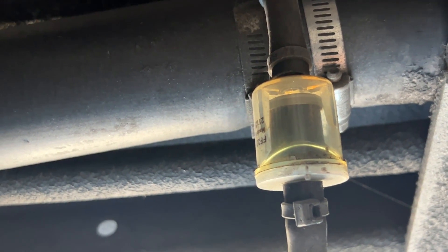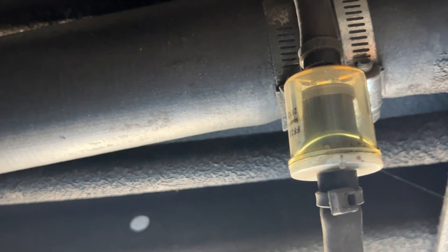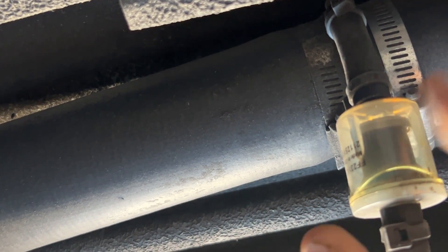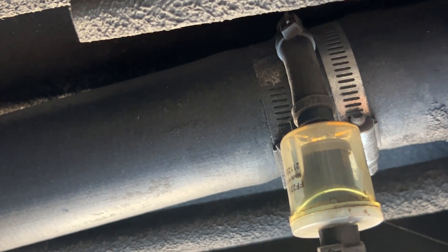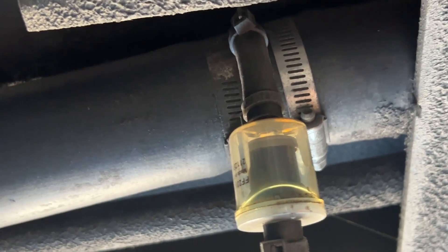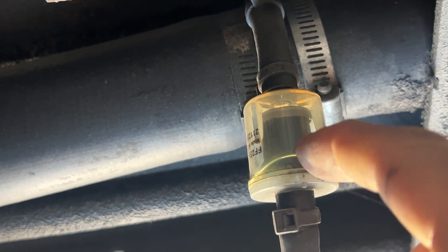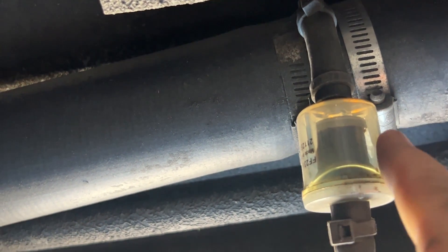Hello, it's Monday December 18th 2023 and we are doing some maintenance on my diesel heater. The fuel filter is dirty and we are going to change it right now. It's a little bit of a procedure because we are above the fuel level in the tank, so as soon as I open this it's going to suck air in. I want to get all the air out of the filter, which I'll show you in a minute, but we have to disconnect this filter and put the new filter in.